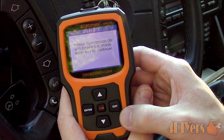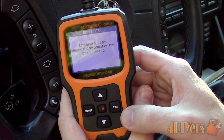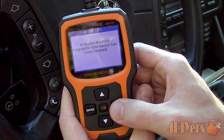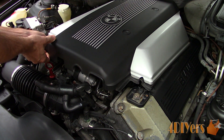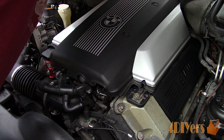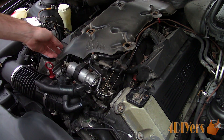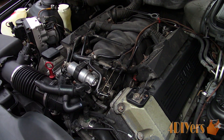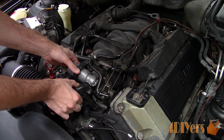For instance, the first fault code is P0505. While this relates to the idle control system, this entails that the engine idle isn't staying within factory specifications. So this could be an idle control valve that is sticking and needs to be cleaned, or perhaps it's slowly failing. There could be a vacuum leak — that could be a cracked vacuum line, bad gasket, or a clamp that needs to be tightened — issues with the mass airflow sensor, and so on. When there are multiple codes, such as the next two which relate to the first one, one error may be causing all these codes. Something like a vacuum leak, for example, would relate to all the fault codes.